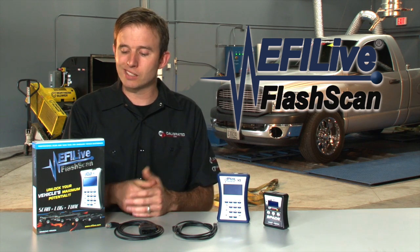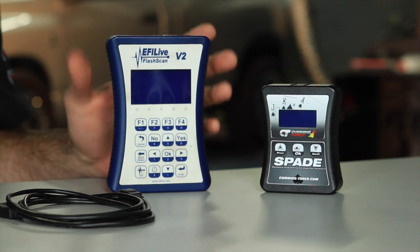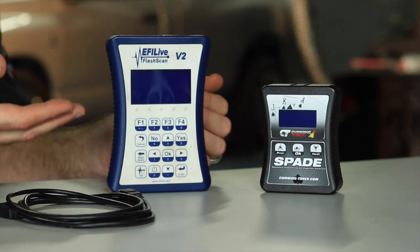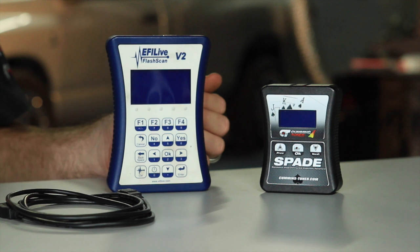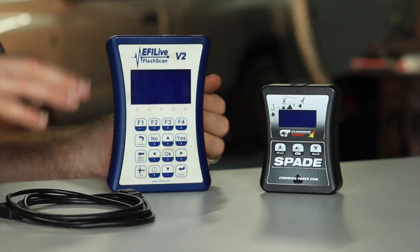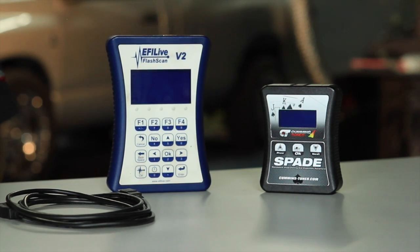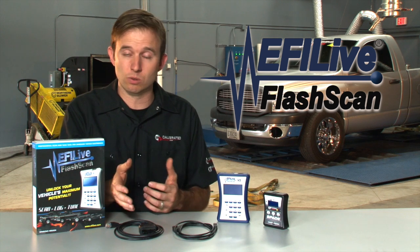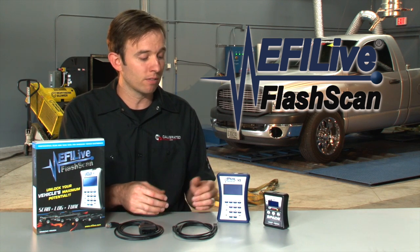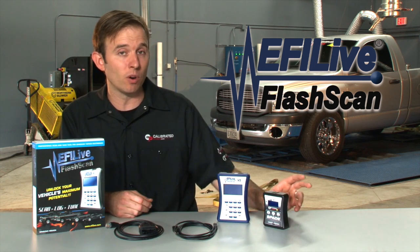So we're really grateful to them. Here we have our V2. This is what all tuners need in order to write the tunes for the truck. This gives you the ability to make modifications to calibrations and actually load them on the vehicle. It comes equipped with two licenses. Licenses are required in order to flash a tune on the truck — or car if that's what you have. If you don't have a license, you can't get the tunes on the truck, so you'll kind of hear us talk about that on the phone.